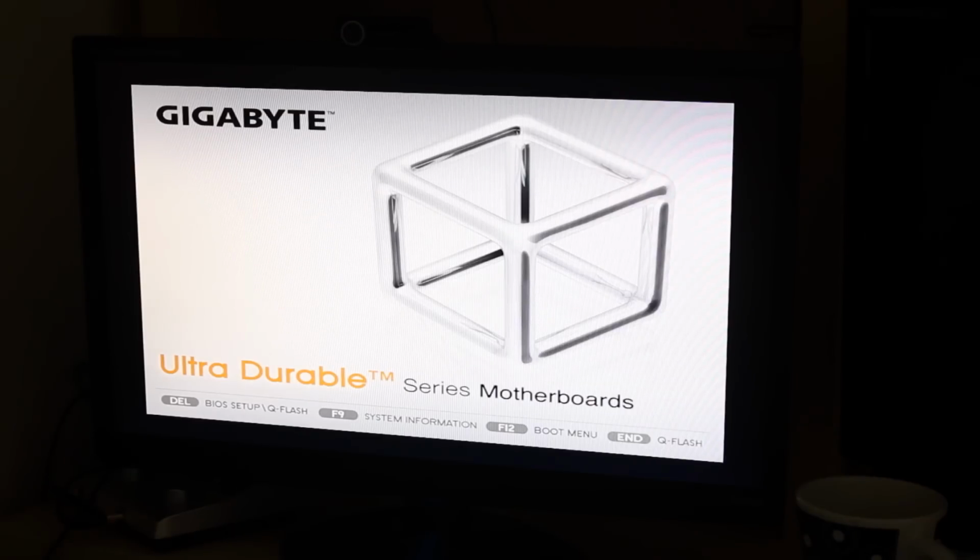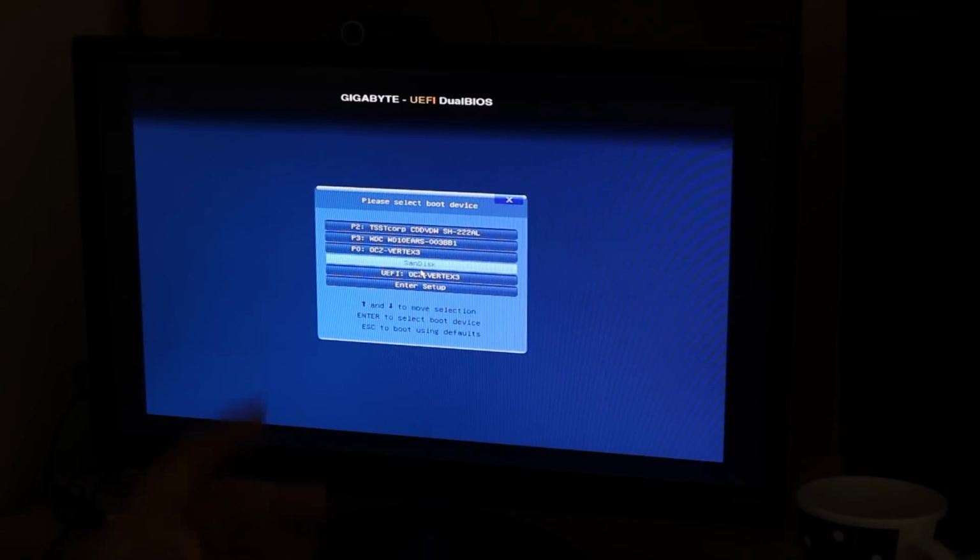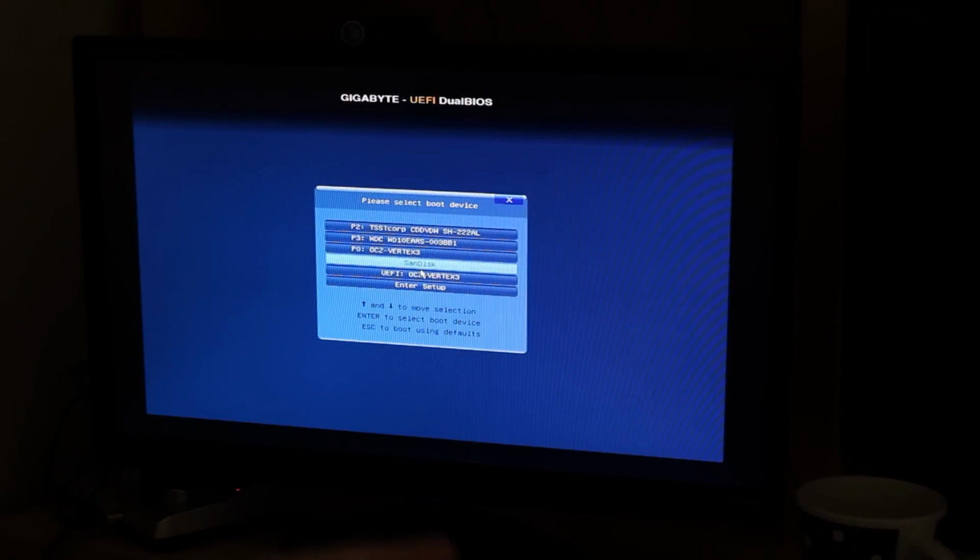I've been using my son's 500GB old SATA drive, but it's only a SATA 2. This is now on the SATA 3 port. Now I know I can probably swap the port, but I'm going to try and get it going without, and that's why I'm having this error. It should have just worked with PCIRoot(UID)=0 all the time. But I think it's because I'm on the 6GB port. But let's try this.